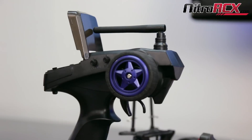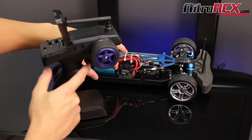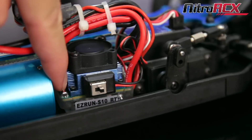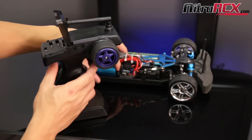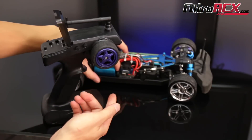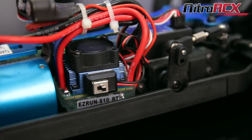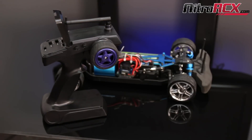The first procedure is to leave the throttle stick in neutral position. With the stick in neutral, push the button once - it beeped and flashed green once. Then hold full throttle and push it again - it beeps and flashes green twice. Then go full brake and push it again - it beeps three times and your throttle range is programmed.